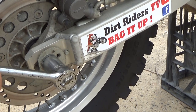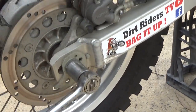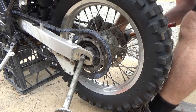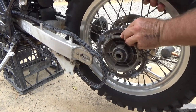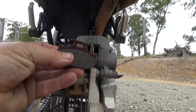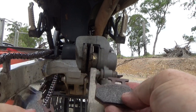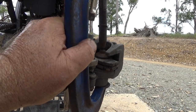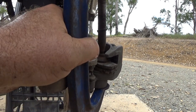First things first, let's take this off the back. It's been on there for some time — drop our chain off and let's have a look. Brake pads both look pretty much the same — easy peasy, that's how they go back in. Let's pop them out. I'm just going to make sure I've got this piston all squeezed in nice and tight with this clamp before I pull it all apart.